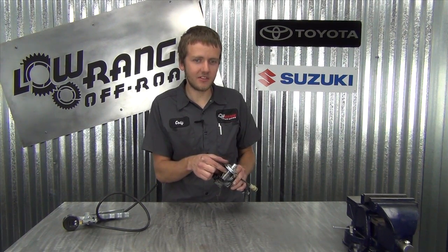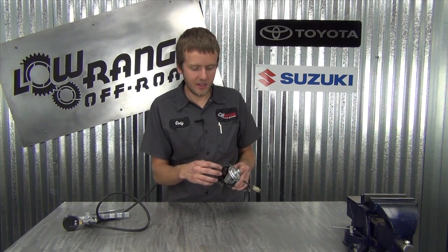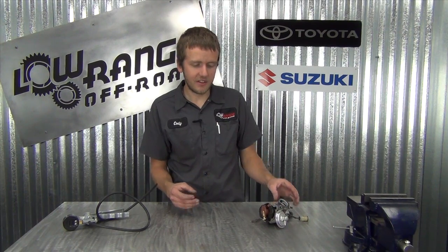Here's the vacuum advanced controller located on the front of the distributor, pointing towards the front of the motor. It comes in and controls the igniter inside the distributor — this is what you're going to want to watch, and it should move 3/8 of an inch once you apply vacuum. What's so important about this working is that it advances the timing just a little bit at high engine speeds, so it improves the performance of the vehicle and you get better fuel economy. We're now going to go down to the vehicle and show you where it's at and how to test it.